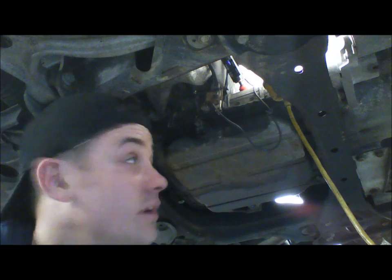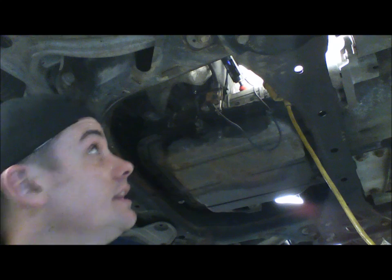Give me a moment and I'll get this plugged in and we'll see what it looks like. As you can see, there's a bright blue spark coming from the spark tester on this car, letting me know that ignition coil is working — not only that, it's working well. If you have a weak spark, erratic spark, a red spark, or no spark, your ignition coil may be faulty. The next thing you'd want to do is take it off the car and do the bench test that I'm about to show you.